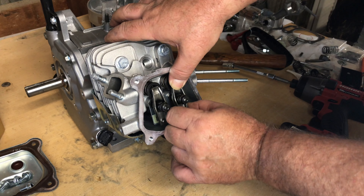I didn't measure the wrist pin on the other engine but this one is 709 thousandths — that's standard clone size. On some engines like the Predators they'll have a 716 thousandth wrist pin, so using one of those pistons with this pin and rod won't be an option.